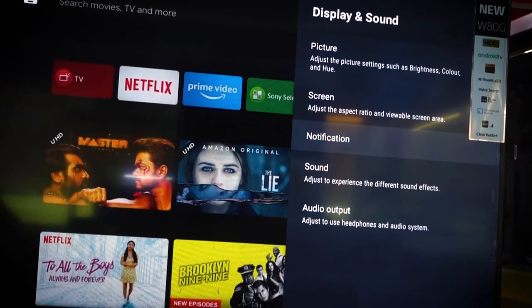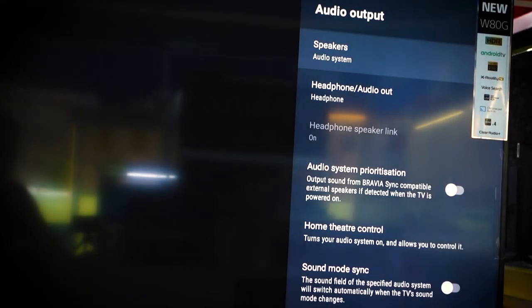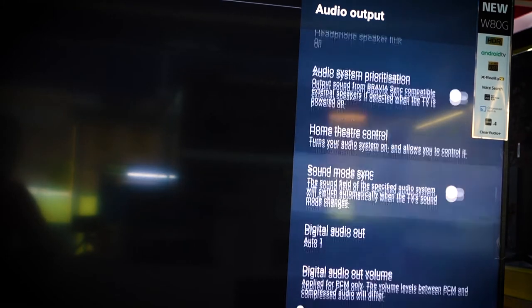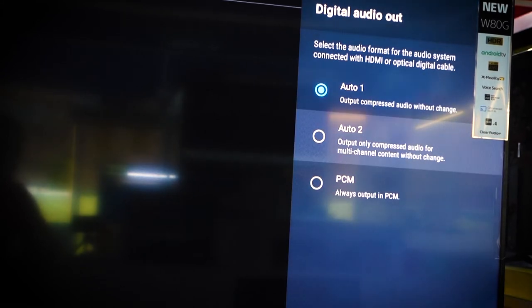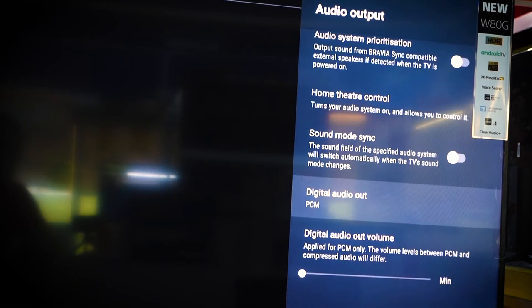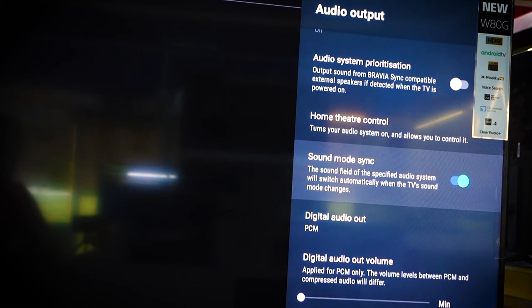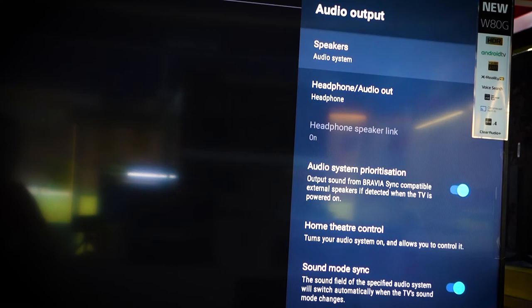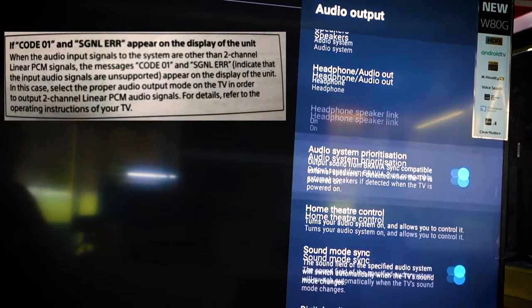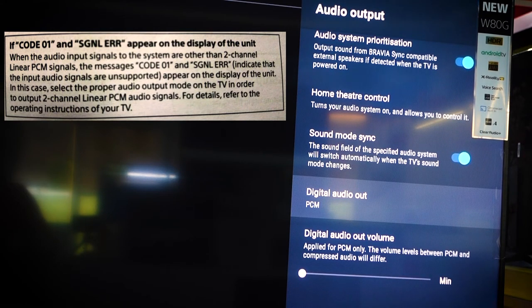The point is the audio output. Because on other TVs, the audio output default for HDMI output is multi-channel. So the M40 or M60 is not supported by that multi-channel signal, because we are only stereo — only left and right. So we need to select PCM. The digital audio output that we need to select is PCM. If you are on any other setting aside from PCM, it's really going to give a code error.